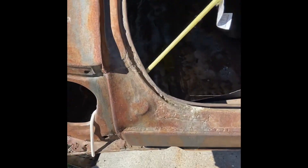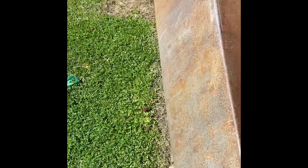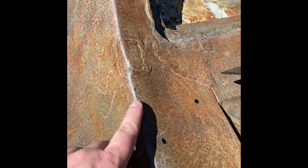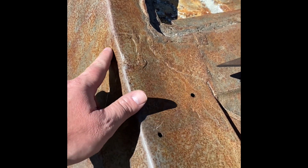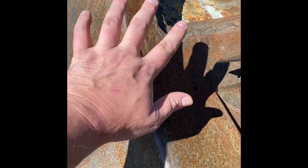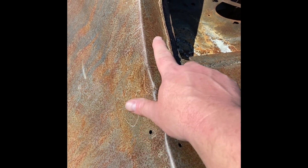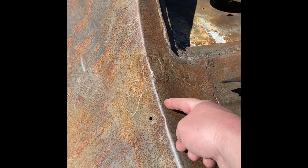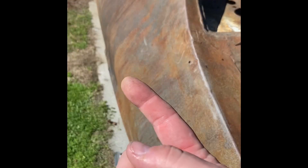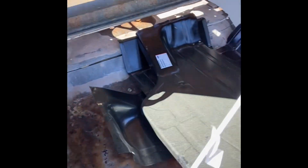Also I've got to try to fix some of this stuff here. But this quarter panel — I'm going to have to change the whole quarter just for the simple fact that they went into this style line here. They drilled some holes to try to pull it out and then they cut and welded this dookie patch in it. It would take at least a half inch of bondo just to make that right if I were to keep it. So I think what I'm going to do is get rid of that and come along here and put a skin — they make a skin that comes right on the inside of this seam — just put that whole skin on and skin this whole thing. That way I can put my brand new outer wheelhouse panel in, and then come in here the same as I'm doing this side and put wheel tubs in. So anyway guys, that's the update for Patches.